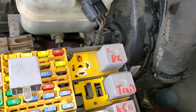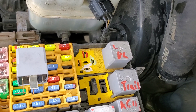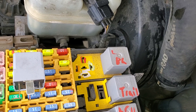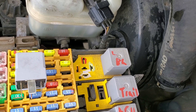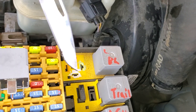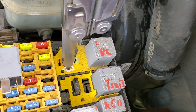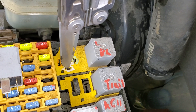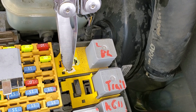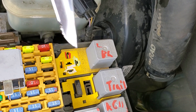I've got these pins color-coded and I'm going to go over in detail what each pin does. The white pin is the pin that actually goes to the starter. If you'd like, you can apply power directly to the white pin and that should engage the starter, if the connection is good, the starter is good, and the battery is good. Just be careful — make sure that the truck is in park with the e-brake on before you do this.